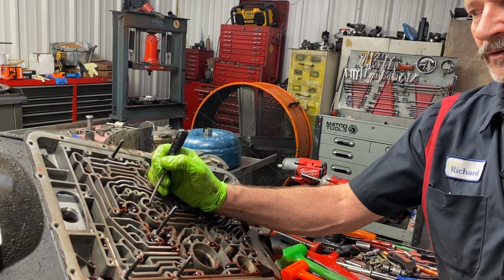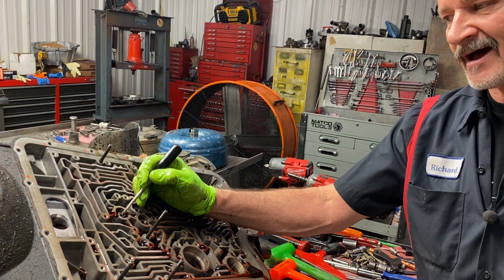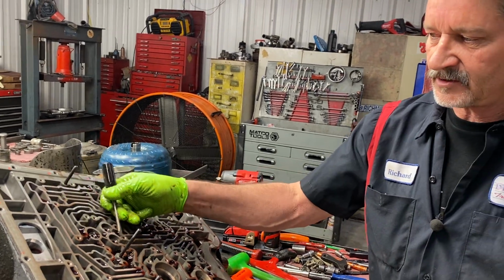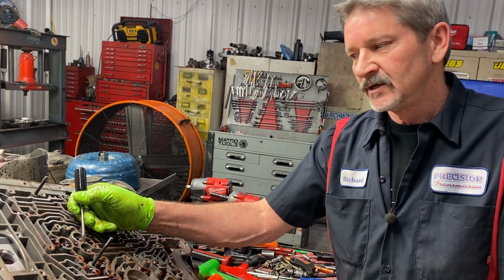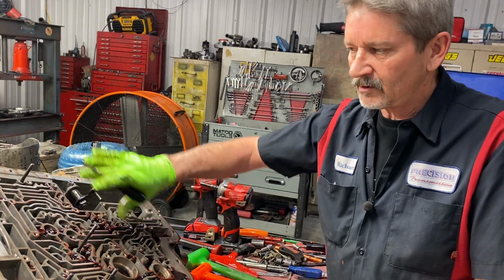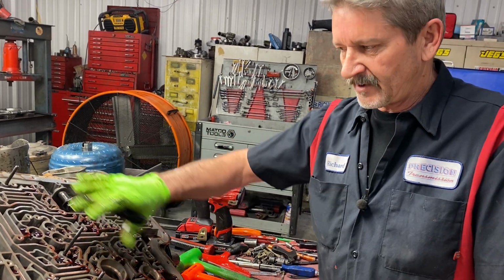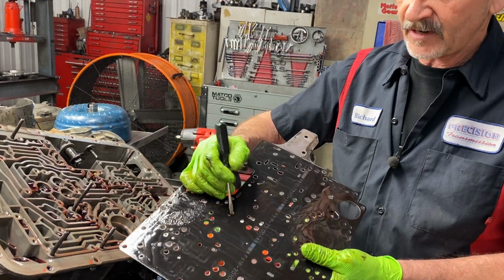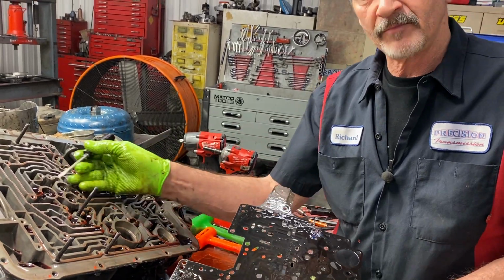These are hollow bolts. They torque down to about 9 to 10 inch-pounds, hardly nothing at all, because underneath these bolts the case is hollow. So if you tighten them down, it will contour it, you know, it'll bevel it like that. Well, this gasket right here is thicker than this gasket right here to compensate for that bow if you over tighten this.